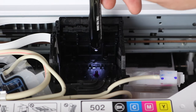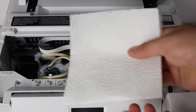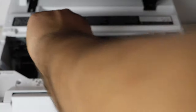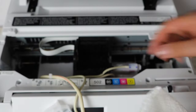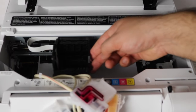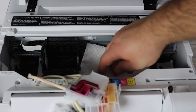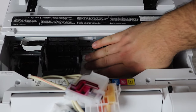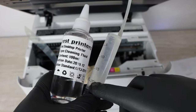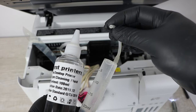Take a look at your print nozzle report and try to pinpoint which colors you need to work on the most. You're also going to want to have some paper towel folded up just like this, and you're going to get that folded piece of paper towel and put it under the print head. Move everything out of the way — as far as these cartridges — so that you are able to place this paper towel under here. This is important because it's going to capture all the excess dried up ink as well as the cleaning solution. Link in the description below if you haven't already purchased one.